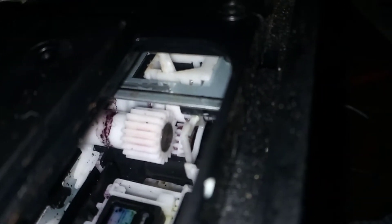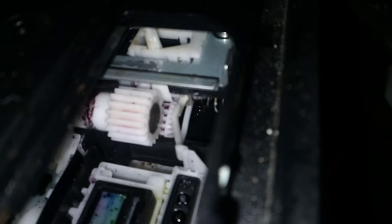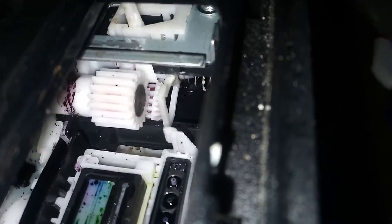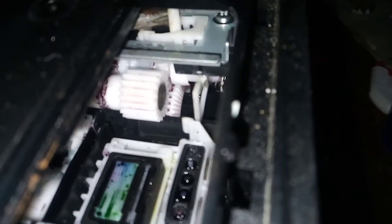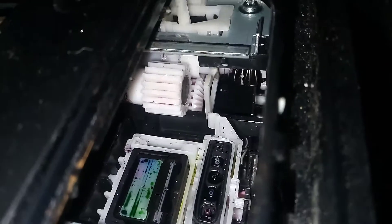Then what we want to do is get some fine machine oil — just squirt the oil right in that section, right in there. A little bit of oil in there, and then simply get a screwdriver and push the actuator up and down to move the oil around. You can see now this is all springy and it comes back really quite fast. And that's it — the printer should be fixed. You don't even have to pull the printer apart.